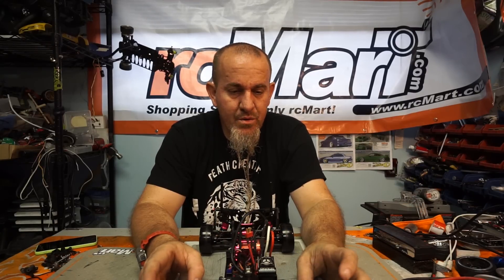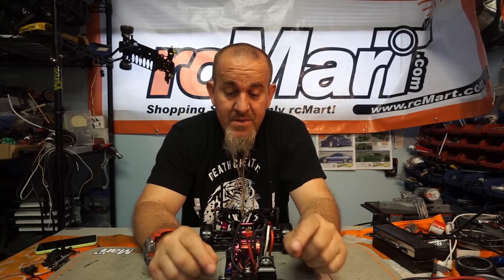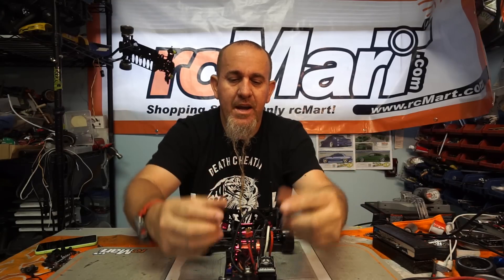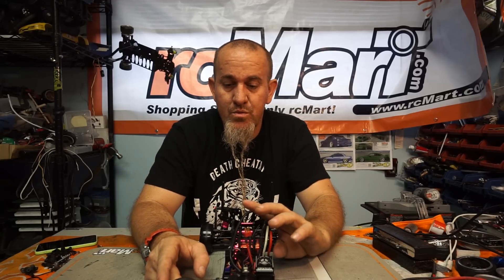In the previous video, we spoke about the KPI, which we have removed by putting these DIB knuckles on. On this specific chassis, there's no caster adjustment — we can't move the tops forward or back. We can move a little bit on the bottom, but at full lock, trying to get that flat contact patch, you will have to add a lot of camber, which will give you the flat contact patch. And it looks pretty gangster if you're driving straight.